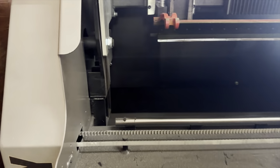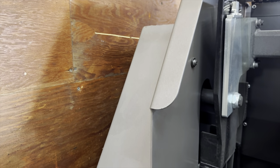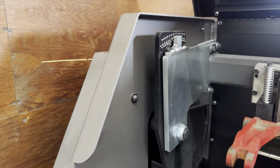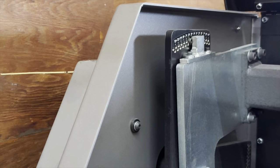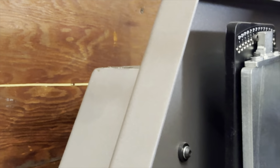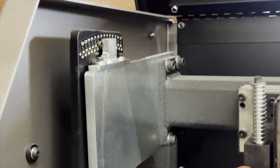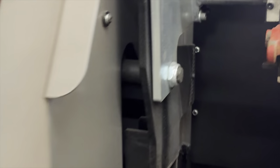Okay, on the left side of the machine, there's an angle gauge and this is called the sharpening angle. What the mechanic told me was that new bed knives are pretty much set to 15. And even if you try to do 13 on mine, there would be nothing left to grind on it. I didn't ask him what angle he set it at, but I'm imagining he did it at the minimal amount. Then in just a minute, he's going to flip the bed knife 90 degrees back, and start grinding the face, and that's where he'll be doing the relief angle.